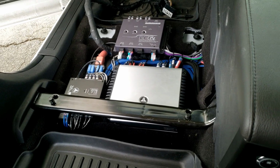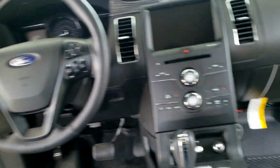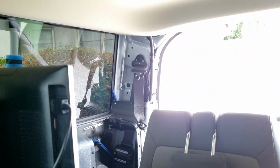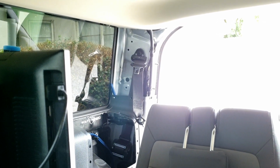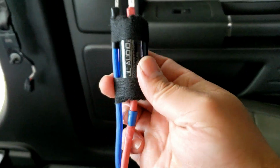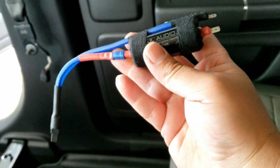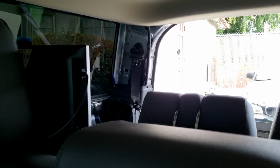This is already finished. So now I can go ahead and put the seats back on for now, and then another day I can come back and tackle the rear quarter panel seats area, well, for the D pillars, because I still have to do those quick disconnect cables or the soldering of that, and then also solder the quick disconnects there. But like I mentioned earlier, I have these plugs from JL Audio that are for the tweeters, like a capacitor, that I have to connect over there. It has to be like a permanent deal already on that side over there.